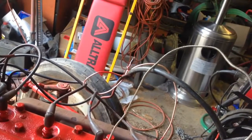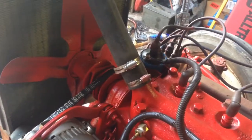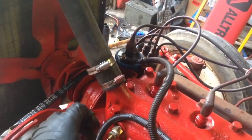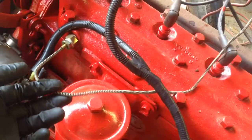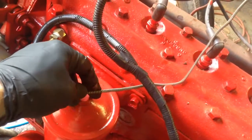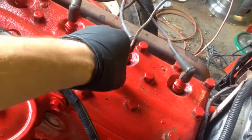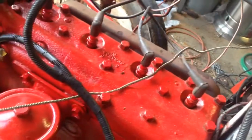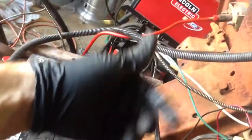So that's it for the temperature gauge install — fairly easy. Just make sure once you get that drilled out, you're really careful, and don't over-tighten these fittings — they are brass. And don't kink your tube here, because it can break or cause it to not work. We'll have to route that and take up some slack; we'll probably coil it up near the gauge.